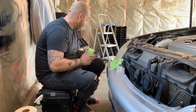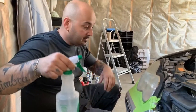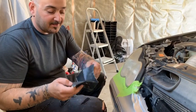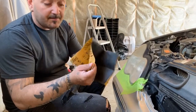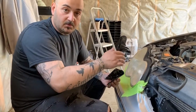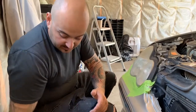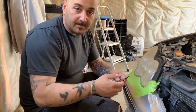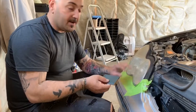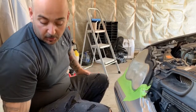All I need is some masking tape, some cleaner, and a bottle of water — I prefer to have a water bottle while sanding. This sandpaper I just used on a headlight, so I have 800 grit for the second stage. I use 400 first — I'll be showing you how to wet it down and sand first with the 400. Different people like higher or lower grit, it's preference. Then I have 1500 grit to finish after the 800. I try to polish it up as best I can, and you'll see it comes out cloudy until we spray the clear coat.